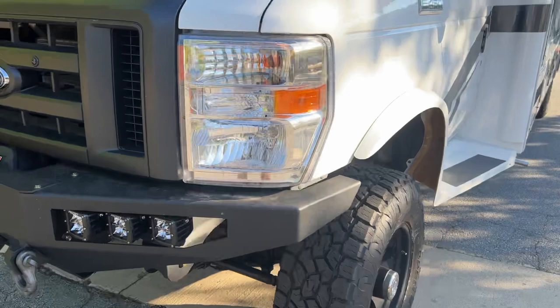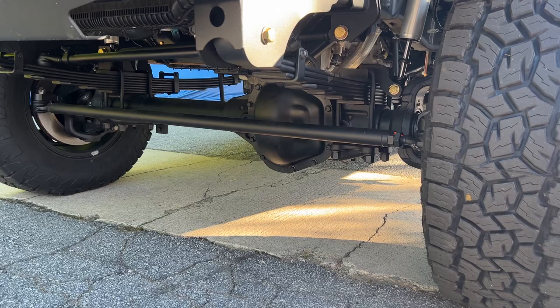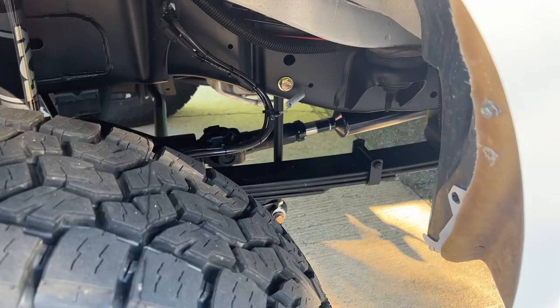It's got a 6-inch lift, still running well with these all-terrains. Front axle is a Stage 2. 4.56 gears, Detroit True Track, RSC upgrade, custom spec springs front and rear, Fox 2.0s. All the usual stuff.